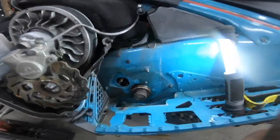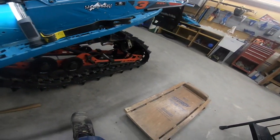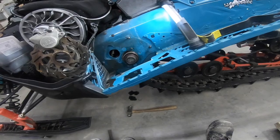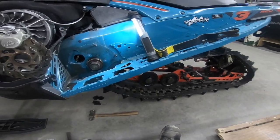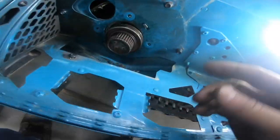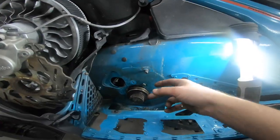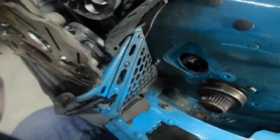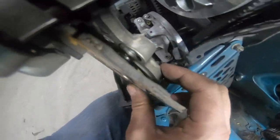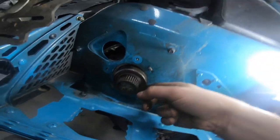A little update here — quite a bit of work. I ended up dropping the skid just to loosen the pressure off the drive shaft for when it does come out, so you don't actually need to pull her but it's really tight. I was a little bit worried for the wall here so I took a second pry bar just to put behind it to widen the pressure point. When you're pulling on that with a puller, make sure you grab the brake caliper bracket, not the actual bearing — I was doing that at first.